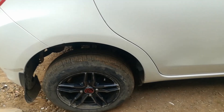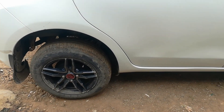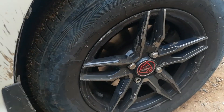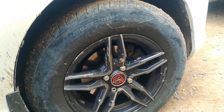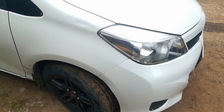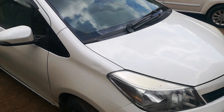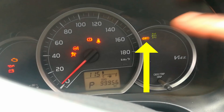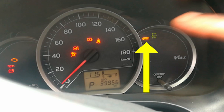As you can also see, there is a lot of space around the rear wheel in the wheel well. Now, when this front wheel moves one revolution, the rear wheel will move more than one revolution in order to catch up, because the same vehicle is moving. And when the four-wheel drive feature is connected and the vehicle is moved for a certain time, you will get this four-wheel drive light coming on, and that will produce the code C1337, which shows that the wheels are moving at different speeds on the same vehicle.